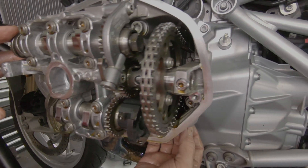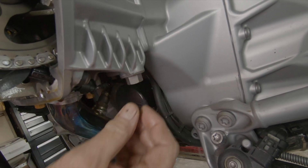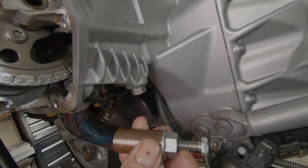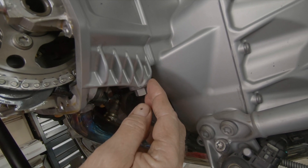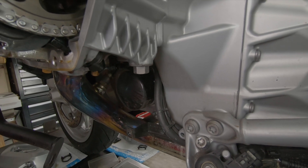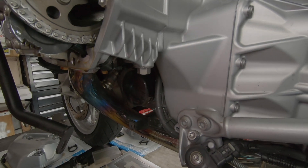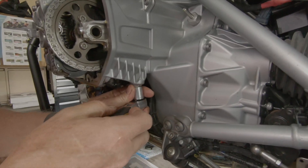The fact that it won't engage shows us that the cam is not in time. This is because we still have the original cam chain tensioner in here. Without the special tool that replicates the running force from the cam chain tensioner, it won't show in time with the jig. We're going to remove this cam chain tensioner and put in the tensioning tool to do this check properly.